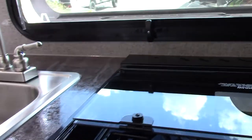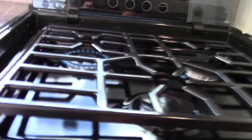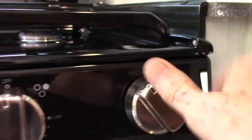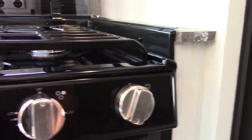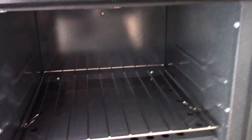For the stove, you just spark the lighter to light the burner. The oven is a bit different — it has a pilot light at the bottom all the way to the back. Turn the oven knob to pilot, then depress and hold it while you spark the sparker. Eventually the pilot light will light; continue holding the knob for another 10 seconds or so to heat it up. Then you can go to your operating temperature. Once you shut the oven off, the pilot light also goes out, so you have to relight the pilot light each time you use the oven.